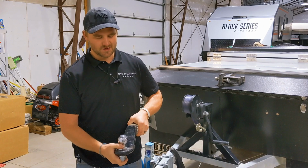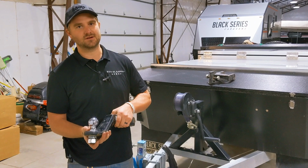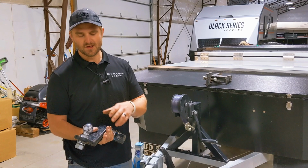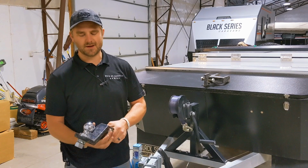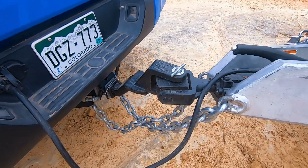Some issues arise for some people, especially in Australia. So Gordon Tregoning invented the polyblock system in 1947, 70 odd years ago, because he didn't think this was good enough for off-roading and for rougher terrain, because it would bind, possibly pop off, and things like that. So on the Black Series, we have the polyblock system, which is really awesome because it gives you a lot more articulation and it cannot pop off